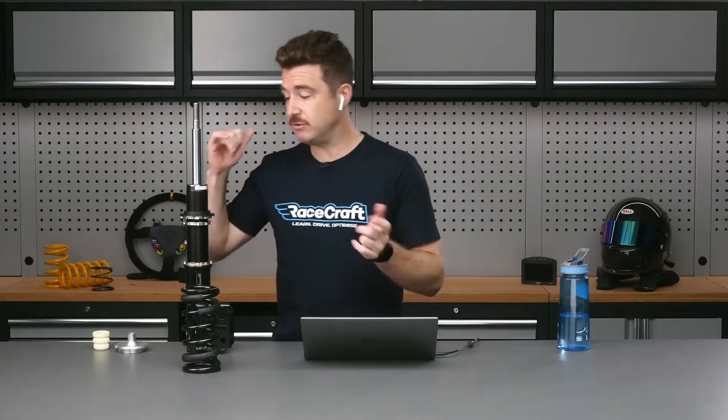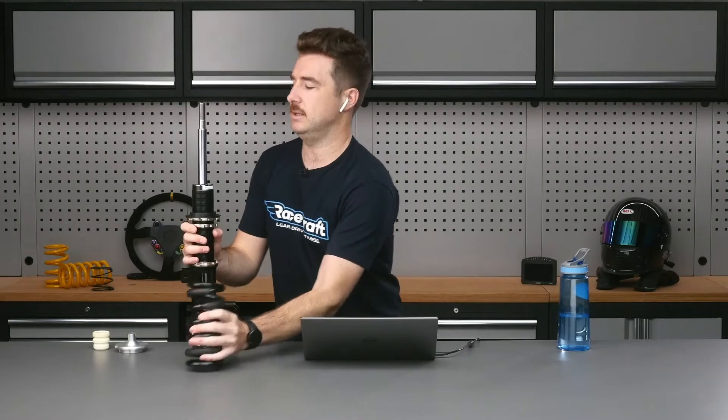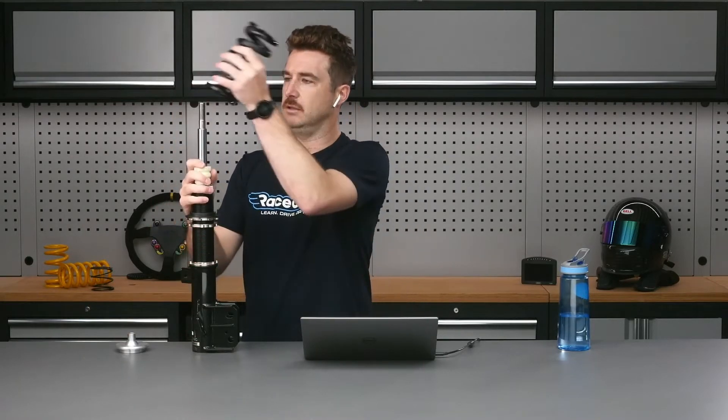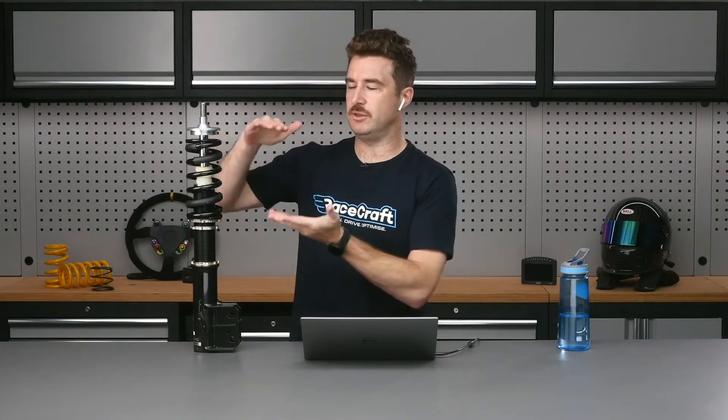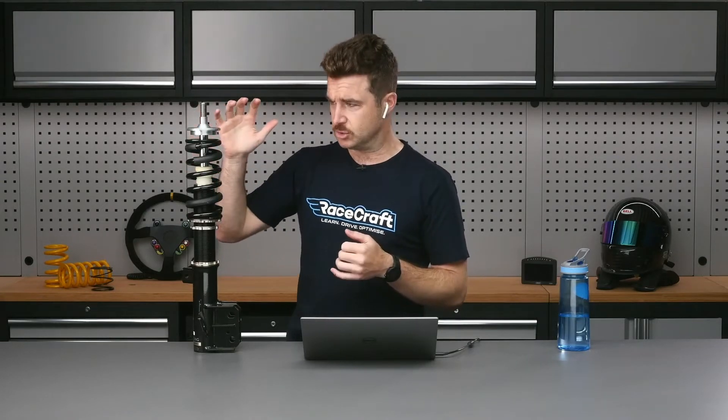I'm really grateful you brought that question up because it comes up a lot. Your ride height and spring setup is determined by the free length of your spring and the rate of the spring, and there are all sorts of different combinations when you go to buy an aftermarket spring — you always get an option on the free length and on the rate itself. So depending on how that packages in your particular coilover, this is how you can end up in the situation PS is talking about.